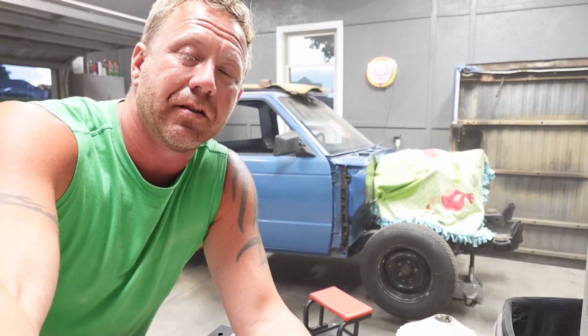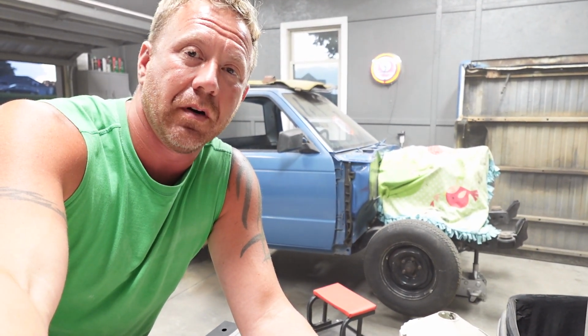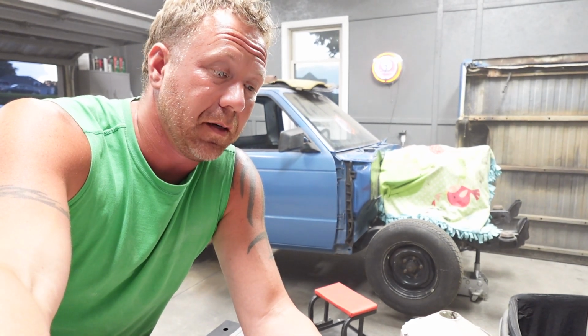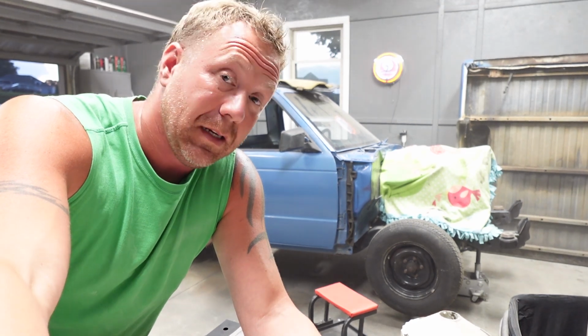We're gonna give that about 10 to 15 minutes to set up a little bit, and then we're gonna come hit it again. Since this is a primer, we're gonna give this probably a day or two to fully cure, and then we're gonna sand wherever the rough spots are, and then clean it up one more time, and we're gonna go hit it with the base coat and clear coat. So I will resume the video here in a couple days.